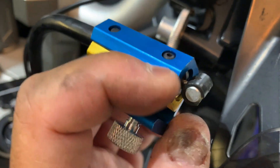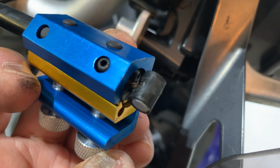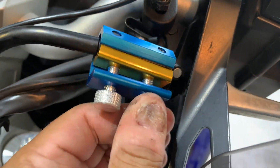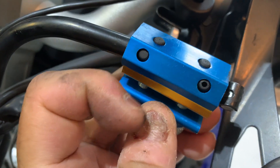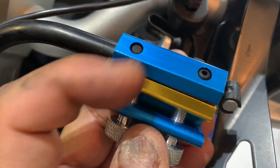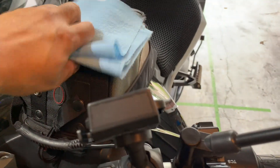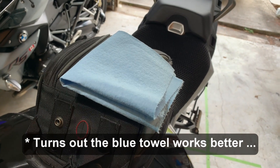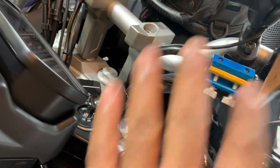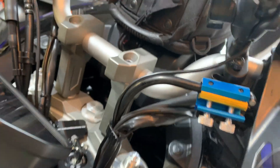There's the nub end on the end of that bladder with the small hole in it. You can probably barely see the cable coming out the small end. This fat end is going in there and you tighten this down as much as possible, because when you squirt there's only one hole you can squirt into. When you squirt the lubricant in there, it should theoretically run down all the way out to the other end. Let me go put a shop rag in there to prepare for the stuff to come out, and another set of rags up here to catch any lubricant that might fly around. Rags are in place.